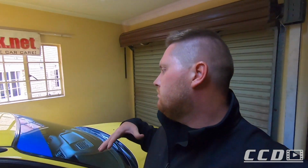I finally got all the readings around the car. Let me just clean you guys up. I'm very happy to say that there's not one spot that is alarmingly thin to me. All is in the region of 600 to 1000, 1100 thereabouts. There's not one spot that I'm concerned about, so I'm extremely happy to report that.